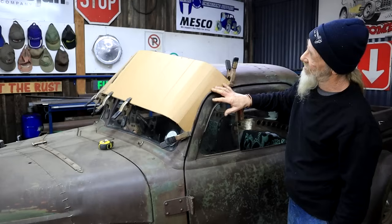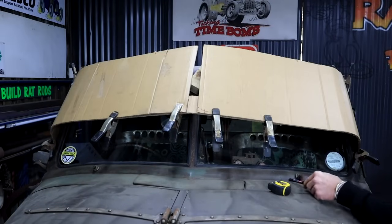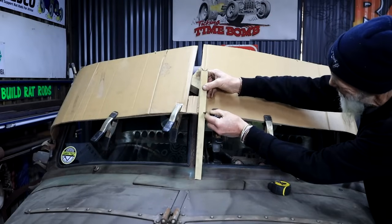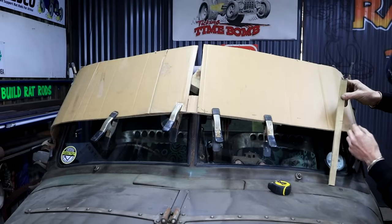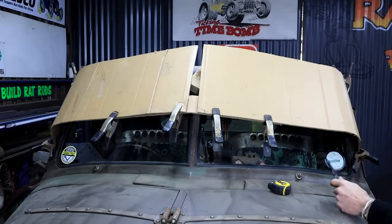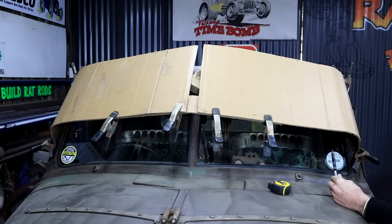I'm just messing around with this a little bit, and once I'm happy with the final shape I can transfer it to sheet metal, cut it out and take it from there. I need to decide where I'm going to cut this — it needs to be parallel to that bottom body line. I'll use a stick to make a mark and transfer that line all along. I've got two pieces: I'm going to cut only one to shape and then use it to transfer onto the other piece so they are symmetrical.